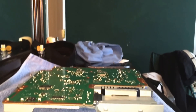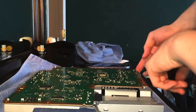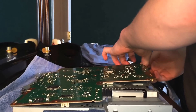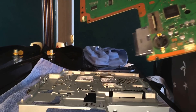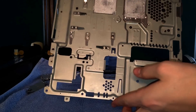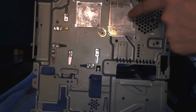Now my best approach is to come here by the USB slot — just lift and it will pop. Lift like that and move that over out of the way. If your PS3 has never been cleaned before, I recommend getting a straight edge razor and shaving the thermal paste off of here and here.